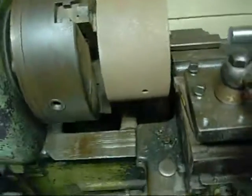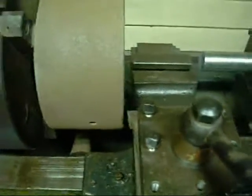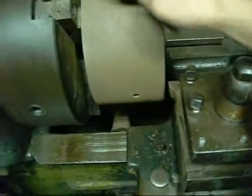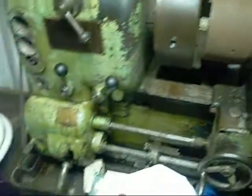I'll just take this pulley out. I was going to surface it on this machine, but as suggested by - I can't remember who, I think Steam Wally or somebody - suggested using an engine lathe with a taper compound and just do a slight taper either side to re-crown the pulley.